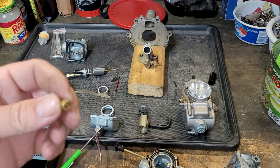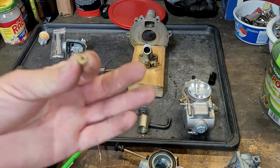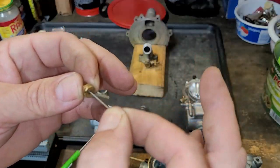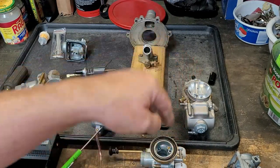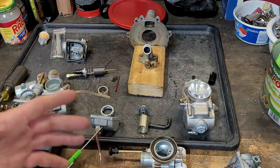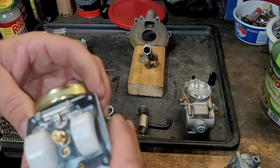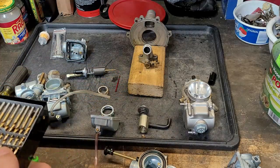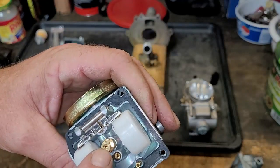Now we're going to take a Mikuni jet — this is actually off a different bike, but I'm using it as an example. This is actually bigger than what we use in our bikes — this is a 95. Here's the 60 wire gauge from that aftermarket Chinese carburetor, and look — it doesn't even fit in there. So it turns out this aftermarket one has a really big jet, actually bigger than an 80. The bike calls for 77.5 to 80 at best. This one definitely has bigger than a 95, so it's probably like a 100 jet. Will this carburetor get adequate fuel? Yes, it will definitely get enough fuel with that large diameter jet.